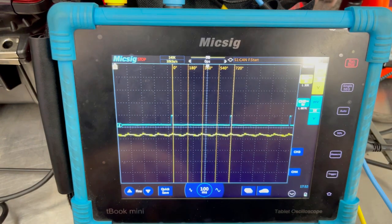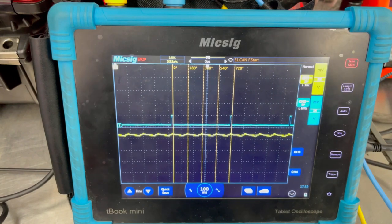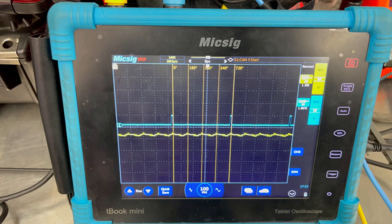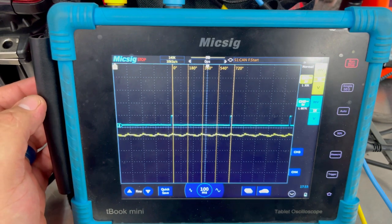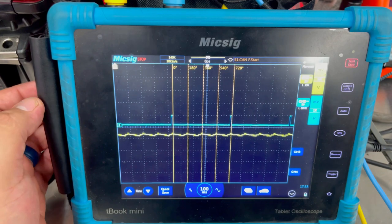What we're looking for is current to go up — in this case it's an inversion of current, which is voltage. We want to see it go up because that's an indication that the starter motor has come in contact with resistance, meaning compression. If we have a good amount of resistance the starter needs to overcome, we know that cylinder has a good amount of compression. By looking at our waveform, we can see that all four cylinders are present and they all look relatively the same — this shows there isn't a mechanical fault.